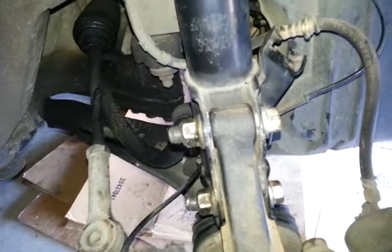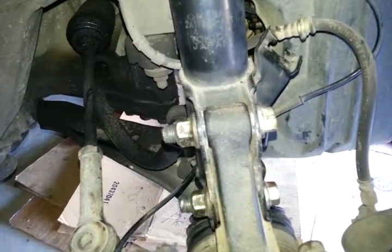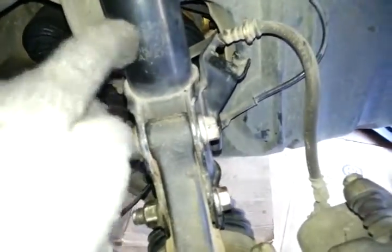When you take off the strut, my mistake was I couldn't get it out, so it fell right into this hole right here and it crimped the bushing here — you can see — because the thing fell in. To avoid that problem, when you remove it, tip it to this side instead so the strut falls on this side to get it out.